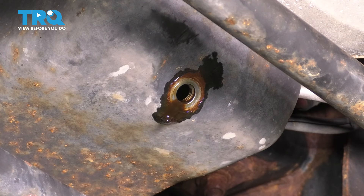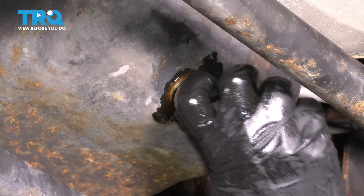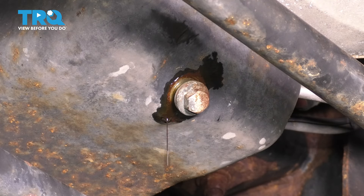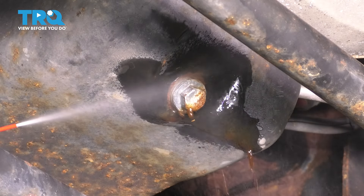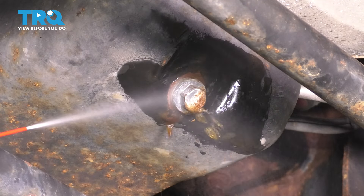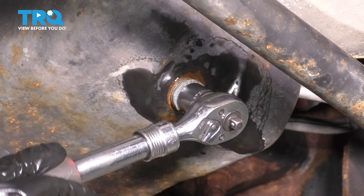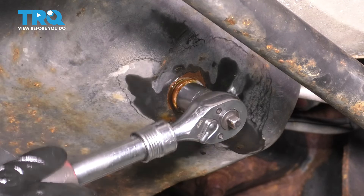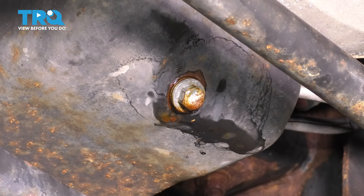It's down to a pretty slow and steady drip, so I'm going to cap it off. If you want to wait longer, go ahead, but I'm going to call this done. Thread the drain plug in — we're going to snug it up and then torque it, and clean up the area. I like to do this right before the drain bolt is about to completely bottom out so that any oil underneath the washer can get out. Then just wipe it — that's snug.